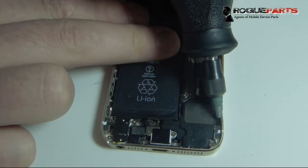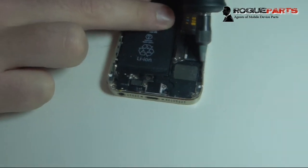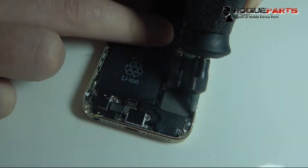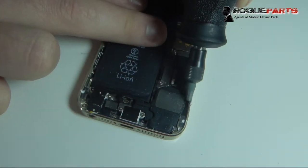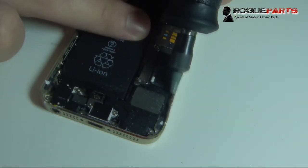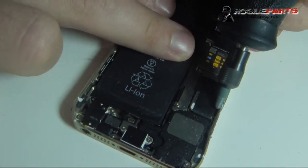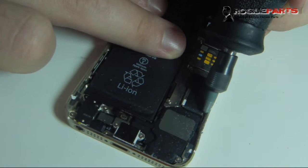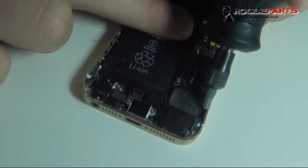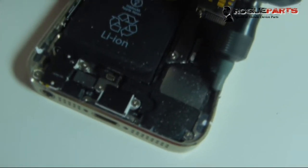What we're essentially doing is we're removing aluminum — really whatever this frame is made out of — from the inside of the device. You can see the technician with the dremel inching in there so that we can fit the screen back in. We're removing layers of that aluminum from the inside. It's critically important to do this when doing a 5S repair that has any kind of frame damage at any capacity.